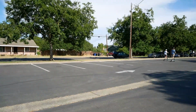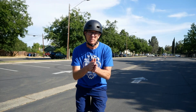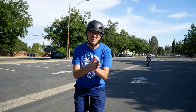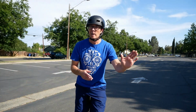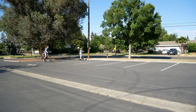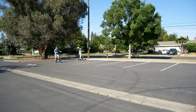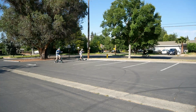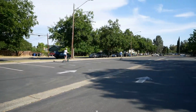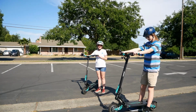Pretty close. So that was pretty interesting, as maybe to be expected. They were pretty much neck and neck, but then the 52 volts on that rear motor, same controller output, so slightly more power, gradually crept ahead. So again, same run. They are in the same scooters, but Milo just switched into dual motor mode. So, I mean, that's pretty striking, the difference, right? When you switch from 1 to 2 motors.